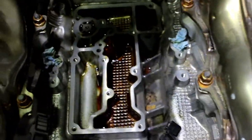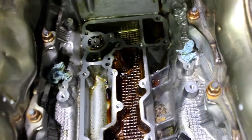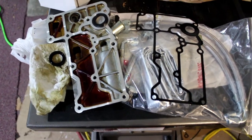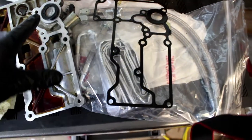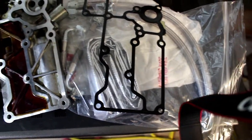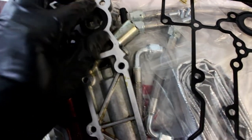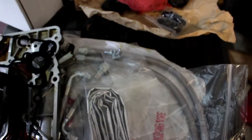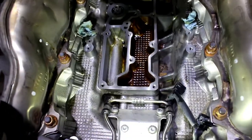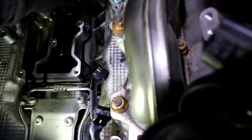We're going to clean everything out a little more and get ready to start the reinstall. Now that we have everything taken apart: here is our cover, the stock gasket plate, and our old cleaned oil filter screen. Obviously we're going to be replacing that screen with a blank. We'll set that in where the stock unit went, bring our stuff back to the car, and we're ready for reassembly. We've cleaned all our surface areas, we're going to drop the gasket back into place and start the reassembly now.